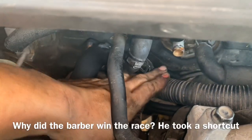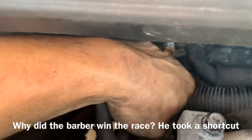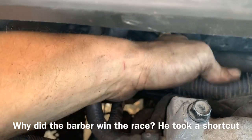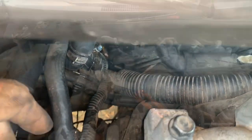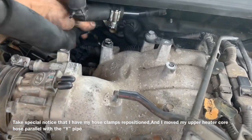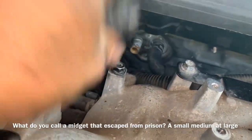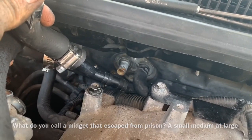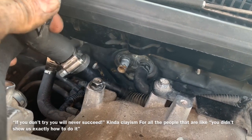It definitely looks like my Y goes over the top of this wiring loom but underneath this other heater hose, because right in between them is that hose that we can't see on the back of the intake. Now I'm going to insert this from the top here and push my hoses around stuff. I want to take the tip — my forward most tip — and get it in between the heater hose and this electrical connector, so right below it but in between it.